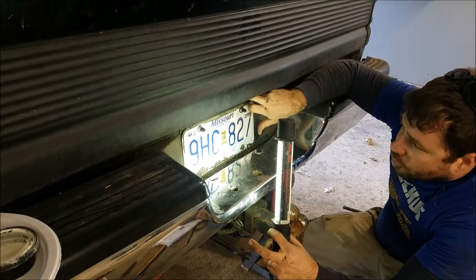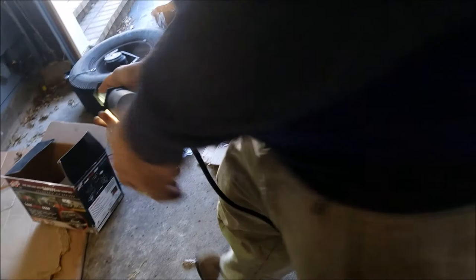You're going to need to drill for the air fitting plate. We needed a 5/16 drill bit to get the right size hole. Measure, double measure, measure again, cut once. Make sure you have a nice clean cut on the air line.